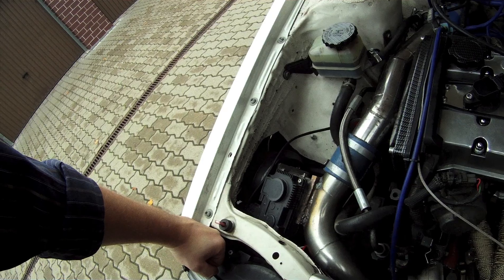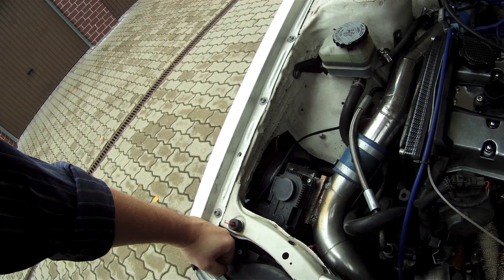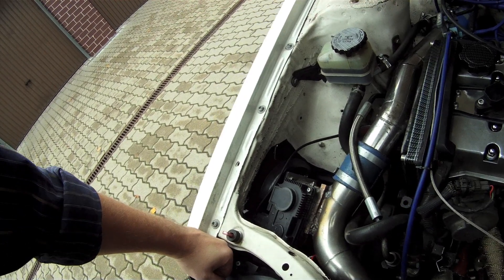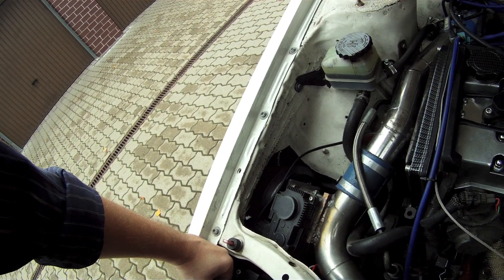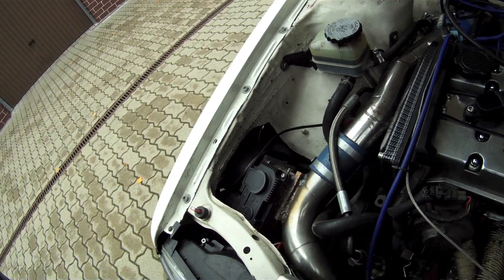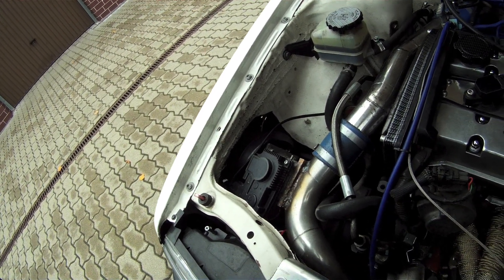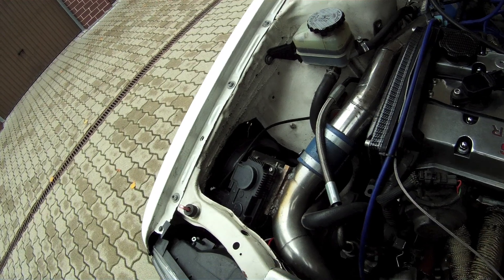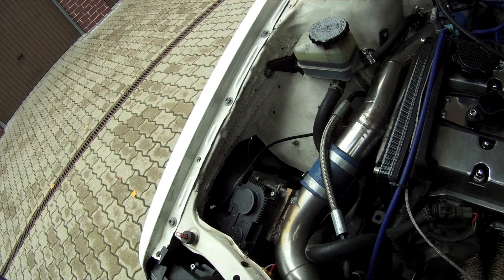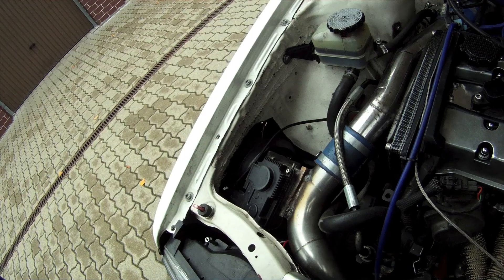You just notice that the car starts pulling a bit better at top RPMs when the supercharger is no longer working and the turbo starts pumping. There are many opinions online that the switchover is problematic and disturbs your power line, but I can say that even without the bypass valve the switchover was very smooth, and now it's even smoother — so I don't think it's really a problem.